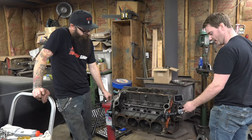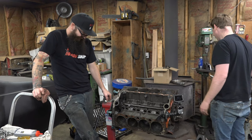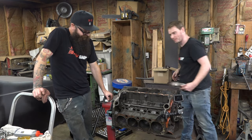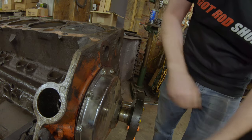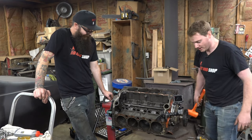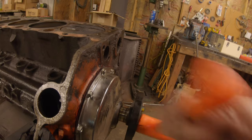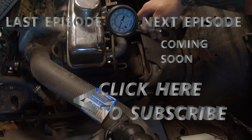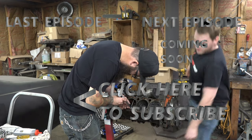For some reason I just had a really hard time putting this on without lining up the timing marks — a little OCD — even though it's gonna have to come completely apart before it gets run. When you put this damper on you're not supposed to hammer it on; you're supposed to use an actual puller/installer tool. Apparently that was news to the engineers at GM back in 1967 because they don't give you any way to do that with no threads in the crank. On the next video we're going to compression test the 350 in the Nova and find out just how bad it is — spoiler alert, it's really bad.